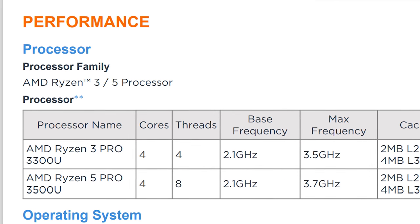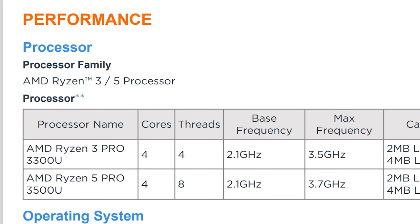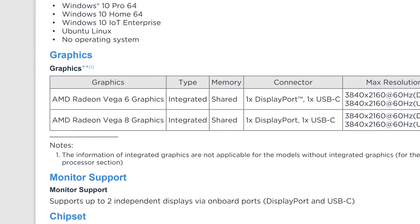The three big differences between those CPUs: the Ryzen 3 Pro only has four cores and four threads — one of the few AMD CPUs without two threads per core — while the Ryzen 5 has four cores and eight threads. The Ryzen 5 also has a higher turbo clock, and you go from Vega 6 graphics in the Ryzen 3 to Vega 8 in the Ryzen 5. The Vega GPU does support DirectX 12, though it's an older generation of IP. These are also only 15W TDP parts, not the full 35W of mainstream segments, so they have less thermal headroom than Tiny Mini Micro nodes.